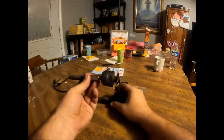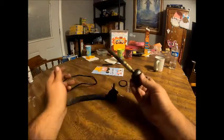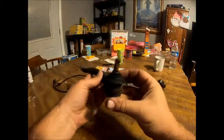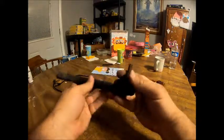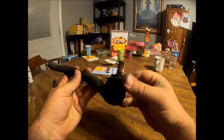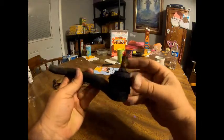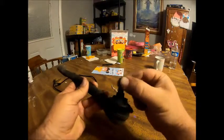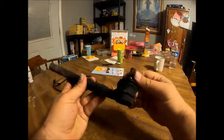Today we're going to go over when you need to replace your inner and outer tie rods. Here is an inner tie rod right here — this is off of a 2001 Honda Accord. If your tie rod ever looks like this, if the boot and little rubber part right here is starting to crack open, it's probably time to repair it. If it's super jiggly like that, obviously it is time to go get a new one.